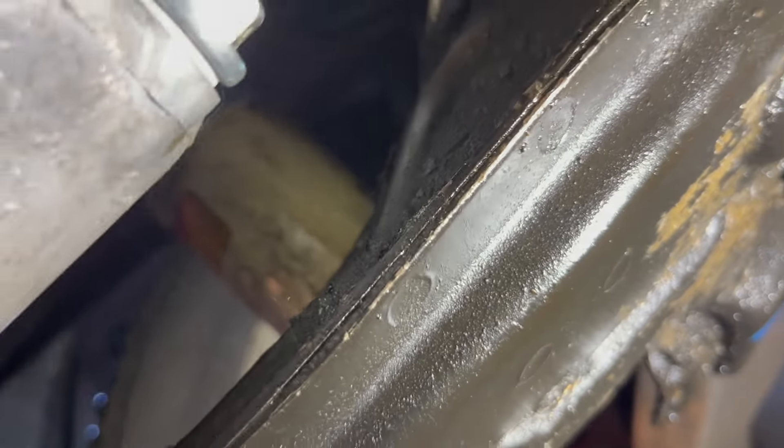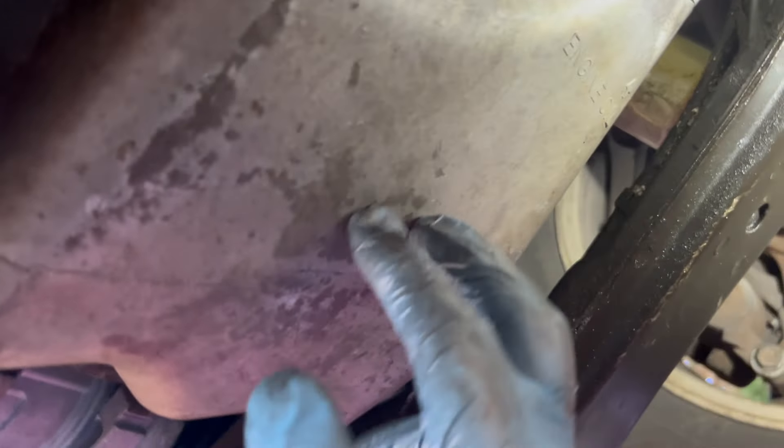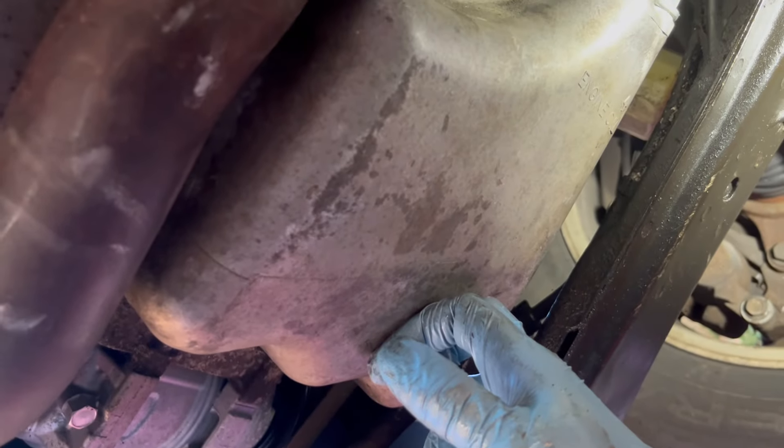Now it's time for an oil change — replace the oil filter, add oil, start the vehicle, and check for leaks. If it's not time for an oil change you can just add oil and check all around this area for leaks. If there are leaks you'll have to remove the oil pan again and reseal it with Honda Bond. I'll leave Amazon affiliate links for parts and tools used in this video. If you have any questions let me know — I'll try to reply as soon as I can. Thanks for watching, see you next time.